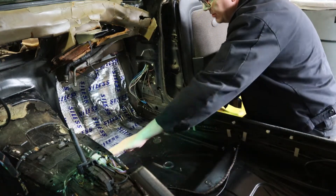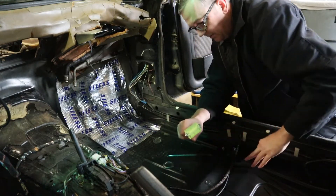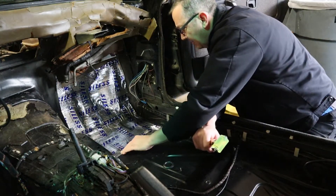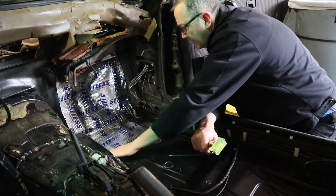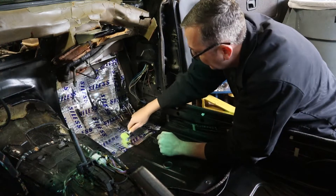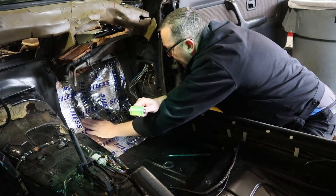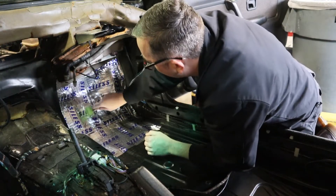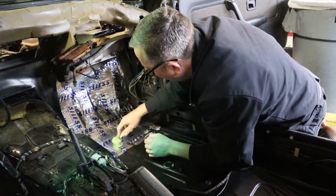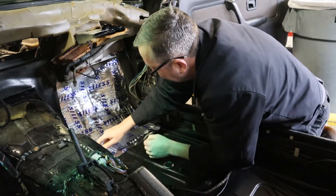Laying in the next piece, you're just going to want to do this like tile — tiling across. You can put a thinner piece in here to fill areas you're not going to be able to get. You can overlap this; I wouldn't overlap it too much just because it'll make things kind of lumpy underneath the carpet. It's more time-consuming than anything. Feel your hand over it — if you feel like you need to re-roll a spot, go ahead and hit it with the roller. And this should really do a whole lot for noise, vibration, harshness, and heat inside the car.